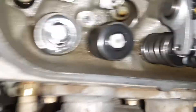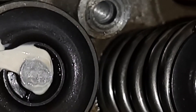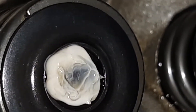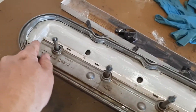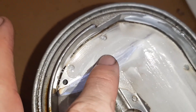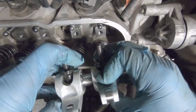I took the tips of the valves as well as the pushrod cup contact point and put lithium grease on them to see the wipe pattern — the contact patch where those components touch. It just smeared everywhere and made a big mess. So I got a Sharpie, cleaned off the mating surfaces with solvent on a rag, and painted them with the Sharpie — the top side of the pushrod as well as the tip of the valve. I ran the test and checked for contact with the valve cover when turning the motor with the valve covers on; there was none.